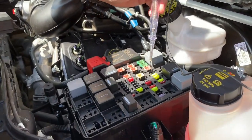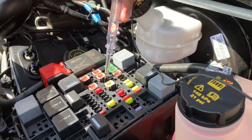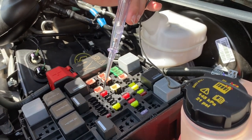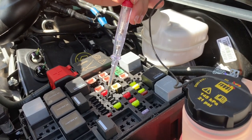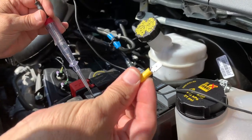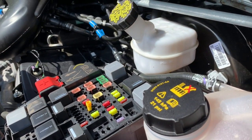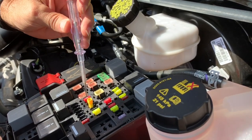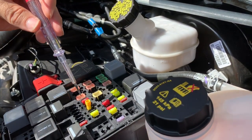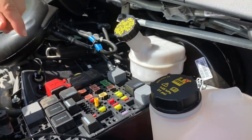The key's off right now and you can see the light comes on — all of these are hot, so we don't want to use any of these. We want the solenoid to not be connected when the vehicle is not running. But these right here — see how no light's coming on — these are not hot, so we can use one of these. Then when we turn the key on, you can see that one is hot now. That way when the ignition's running, this wire will become hot, which will activate the solenoid and allow the house batteries to charge while the vehicle's running.